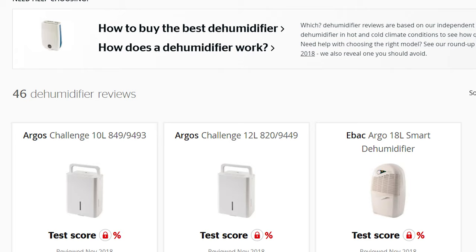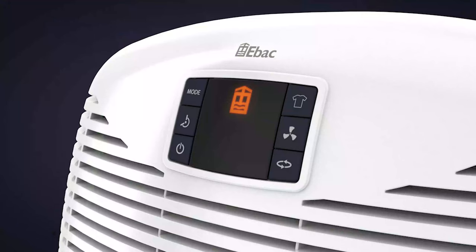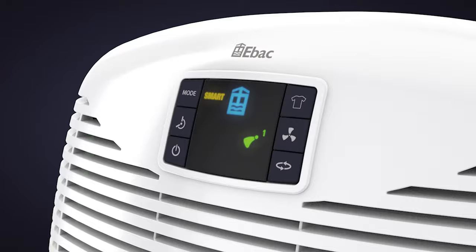The consumer group which has done some best buys on dehumidifiers has used the wrong basis, in my opinion, on deciding what makes a good dehumidifier. They think the most important point is the amount of water it extracts, and they test dehumidifiers at two conditions — one of those is 10 degrees centigrade, which will very rarely occur in a house which is occupied during winter. If you have a dehumidifier with a high extraction capacity and it doesn't have a very good control system like our smart control, it means it will run far too much and increase the running cost significantly.